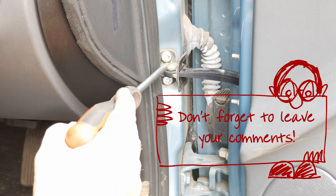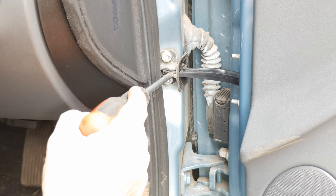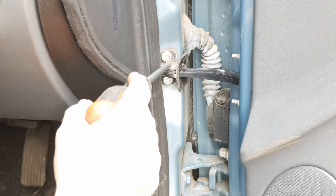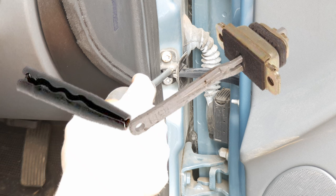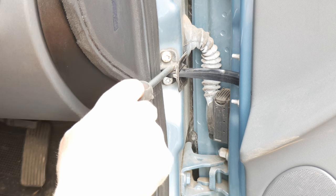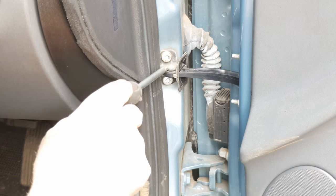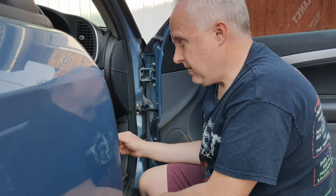On some cars the noise can be the result of either the hole in the check arm or the pin that holds it to the bracket wearing inside there. It depends very much on the design of the check arm — I'm thinking of cars like old Rovers, Rover 800 and 600. If that is the case, you could either replace the check arm, but that does mean taking the door completely to pieces to get it out, or you could conceivably drill out the pin and put a bolt in its place. Something that sounds horrendous but is an easy fix.